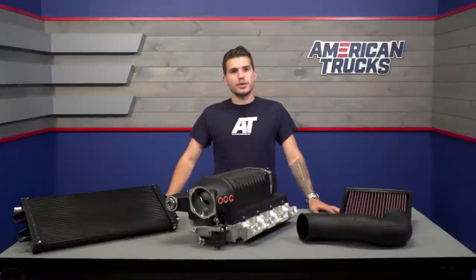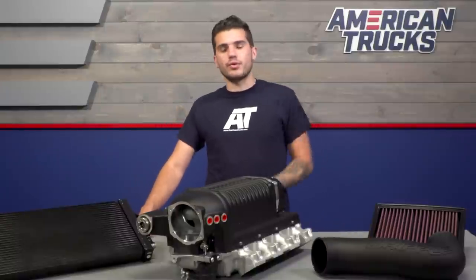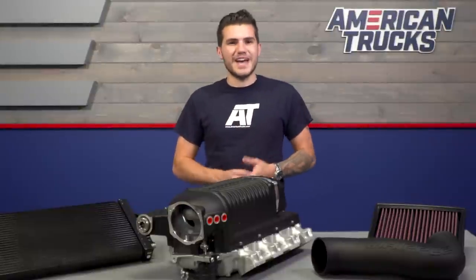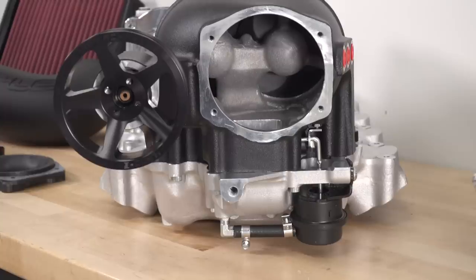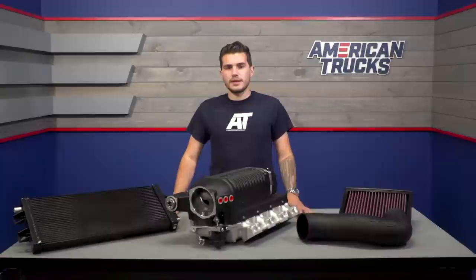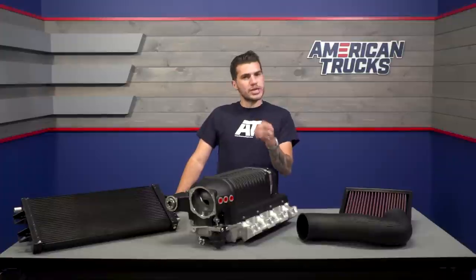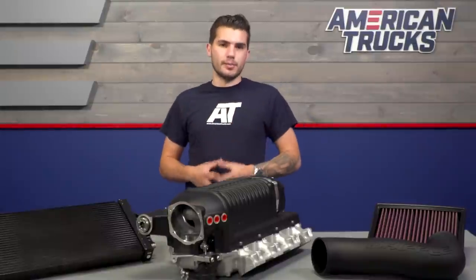For those of you who aren't necessarily doing all the towing and hauling but might be interested in that serious power gain and muscle that the blower adds to the 5.3, this is a great choice. You can generally expect power gains of up to 150 rear wheel horsepower with this twin screw system, which is ready to go right out of the box at about 7 to 8 pounds of boost. The TVS, or Twin Vortices Series supercharger, is really a staple in the blower community. That rotor style option that Whipple's got here offers a sizable gain in horsepower and torque. The general claim is on 7 to 8 PSI you pick up somewhere up to 150 horsepower, which is currently the most power-per-pound option on the market. It's got a flat torque curve, which helps with acceleration all around the RPM band.